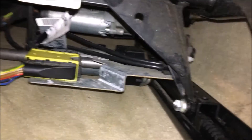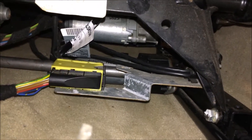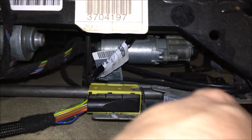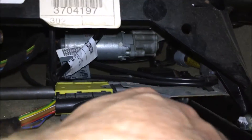Now this is the connector under the seat. I wanted to show you really quickly how to remove it, because you don't want to go yanking on it — you know, pulling out the seat but still having this wire attached. There's a tab; take a skinny screwdriver and pull it this way.